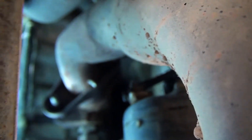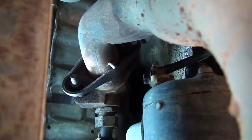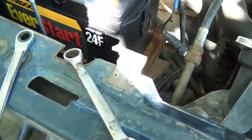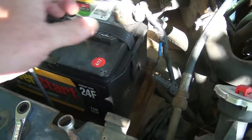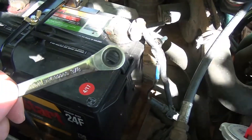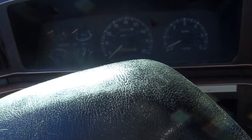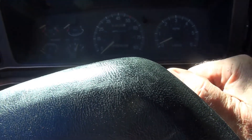Okay, cable's back on — all good and tight. It is not loose. Let's go give it a try. Everything's reconnected. The battery terminal was a half-inch wrench. The terminal on the starter that I tightened up was three-eighths. Let's see if tightening that loose cable fixed the clicking no-start issue.